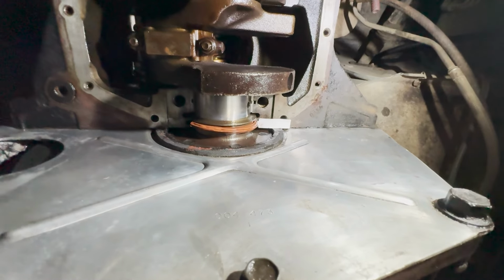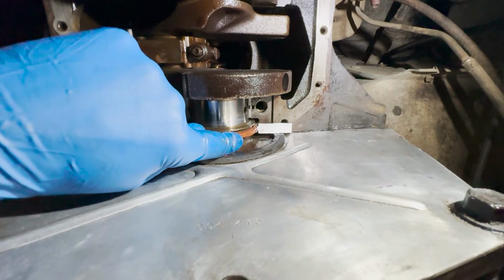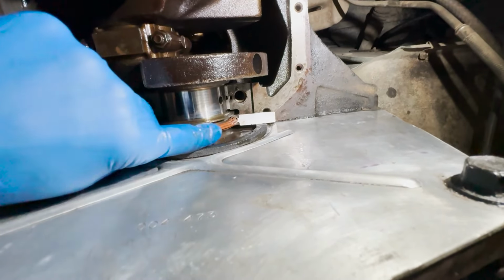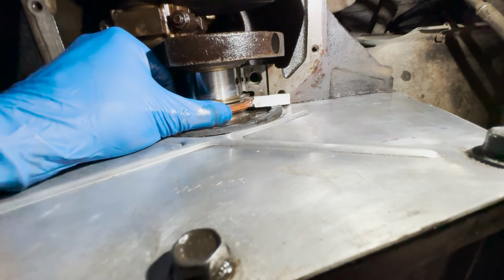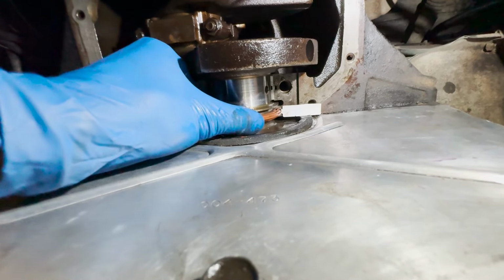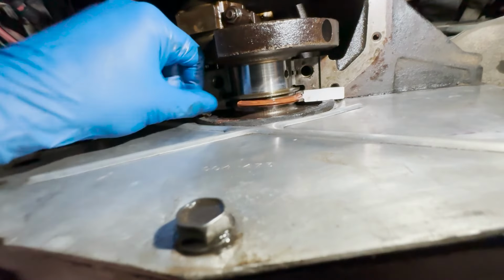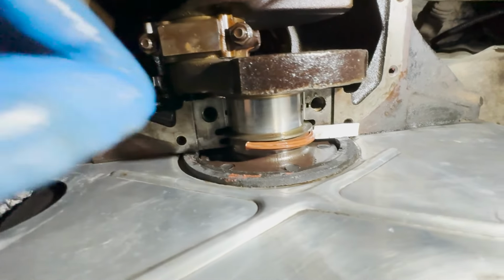We're back in the land down under. And here's how that little shoehorn goes in. Just pop that in on the edge and then just start the seal. And this is lubricated. But that shoehorn will stop from ripping the edge of the seal on the rough surface of the block. So then from here, I'm gonna guide it with two hands. It's gonna be tough to show you with one. You can just kind of maneuver, oh, there we go. Maneuver that around. See there, about a third of the way in.